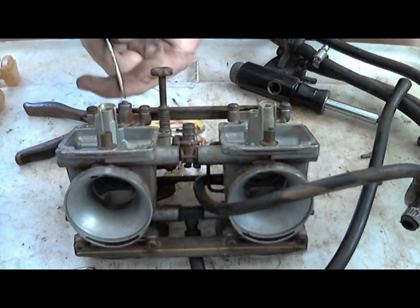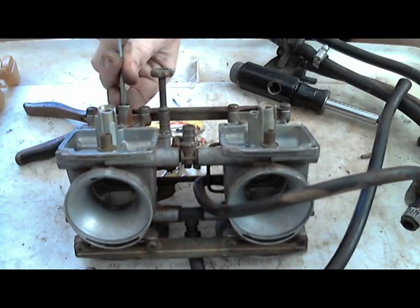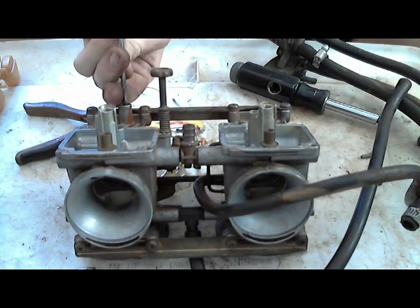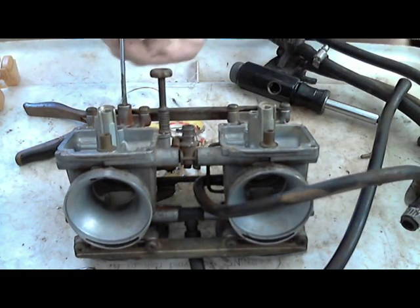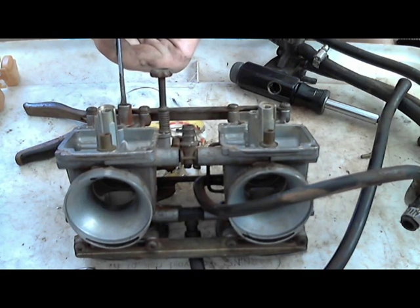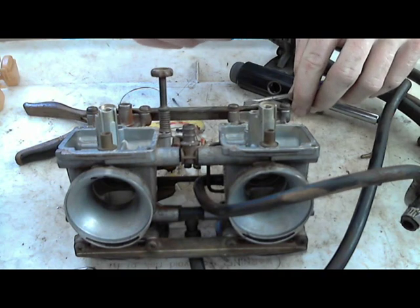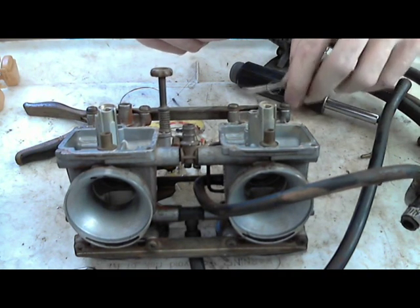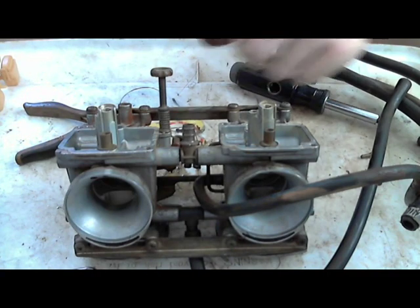So put this back in. Tighten it all the way to the bottom. And like I said, you don't want to over tighten this. Whenever you're tightening it down, you want it to stop where it is, which is there, and then count again, 3.5 turns, just like this one. Half, one, half, two, half, three, half. Okay, and the screw heads may not be facing the same direction. Like this one, it's turned more sideways, and this one's almost level. That's almost straight.